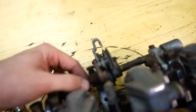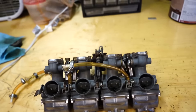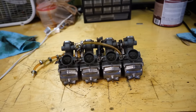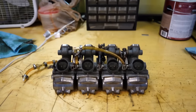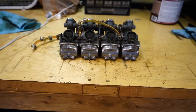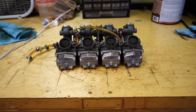The carbs are a little rusty on the top but overall they seem to function pretty well. I'm going to pull all the bowls off, pull all the jets out, kind of spray it all down and spray through all the passageways with aerosol carb cleaner. I'm going to check the jet size - on my last bike I ran a 110 jet with pod filters. The guy I bought it from said they'd already been re-jetted for the pod filters, so I'm assuming they'll be very similar.